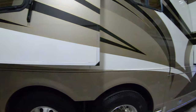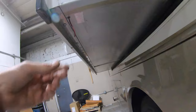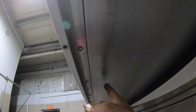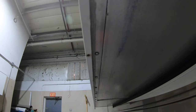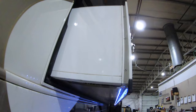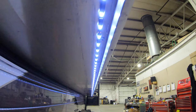We're going to go inside the building now and take a look at this 2007 — we've done all the LED lighting upgrades on it. On this particular coach I'm doing the passenger side. I've got my wire coming out the floor here, and you check and see where your wipe seals land. On this one you can see right here — that's where they land, so the light ends up right here on this edge and it'll clear your wipe seals.